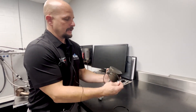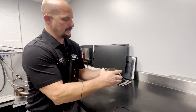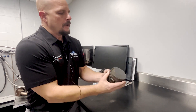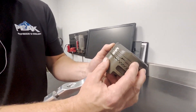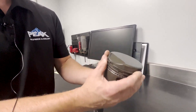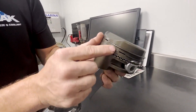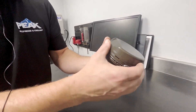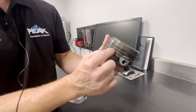We'll take our second compression ring — there's a top and a second compression ring, also called a wiper ring. Both of these are directional for compression. On the piston, we have the gap; this compresses down into the sleeve through a ring compressor, maintaining the specific gap predetermined by the crew chiefs. Under the compression stroke, it has these little gas ports. Compression comes down the side of the piston, gets behind the ring, and expands it to make a gas-tight seal to the cylinder walls. The second ring does the same thing and also removes excess oil, returning it to the oil ring, which puts it back to the crankcase.